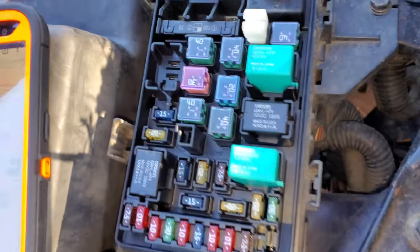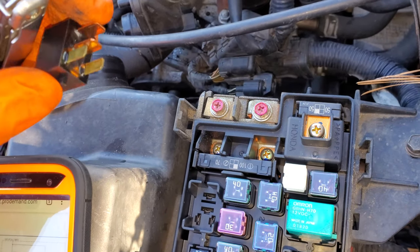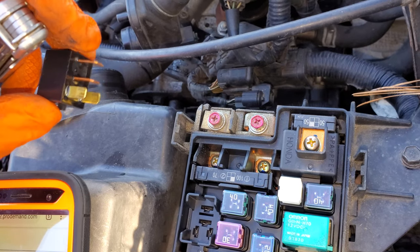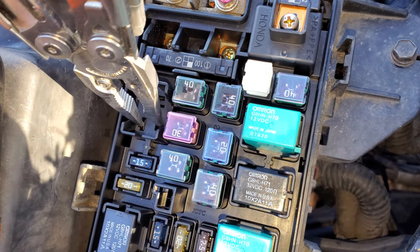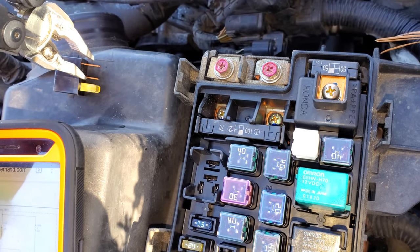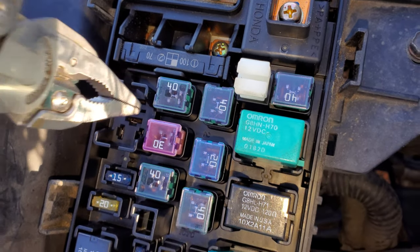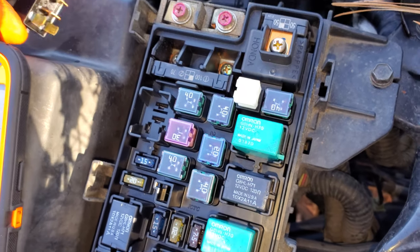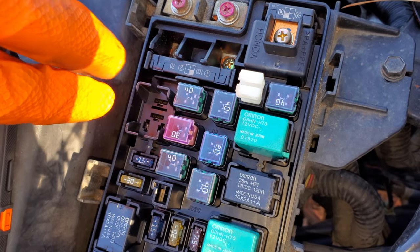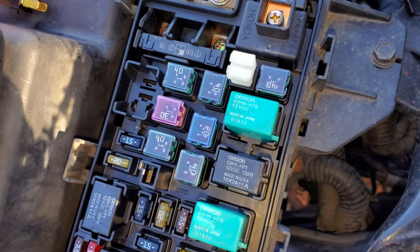While I have this off, I want to point out a few things about this relay. You'll notice two of the legs are skinny and two of the legs are thicker. The skinnier legs are what receive the electrical signals to get activated — these two pins right here. When the relay is activated, all it does is connect the two larger pins together. One of those pins receives power from the fuse; the other pin goes directly to the fan. So if you pull a relay out and use a thick paper clip or some wire, you can actually connect those two legs together and see if the fan comes on when powering it directly.